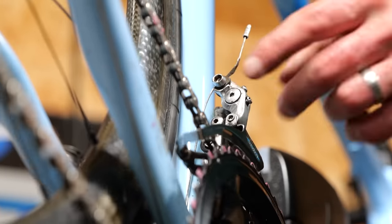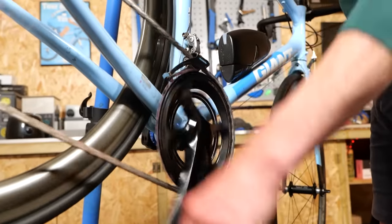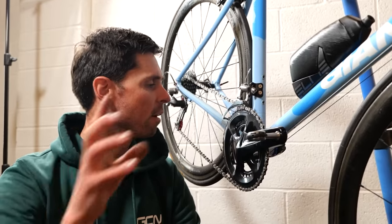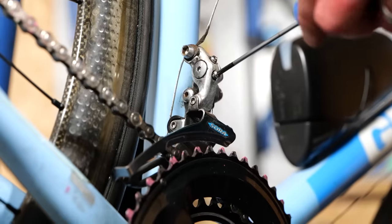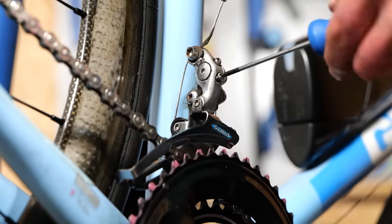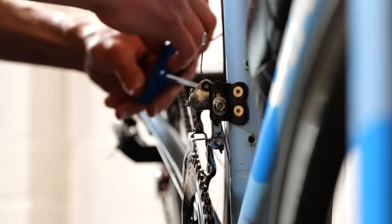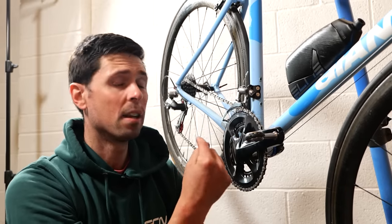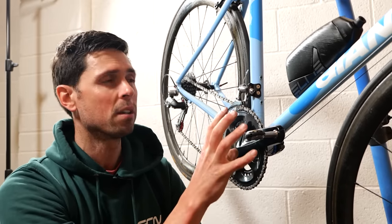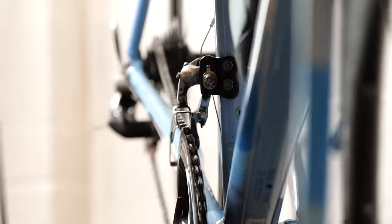After a couple of minutes of trial and error, I've worked out that the best position for the shifter is the middle and outer chain ring. That works best and gives me that little extra click to trim the front derailleur. I've set the limit screws accordingly to the position of the inner and outer chain ring for the double crank. Shifting from the small chain ring up to the large chain ring is not seamless but it kind of works. Shifting back down to the small chain ring works as you'd expect.